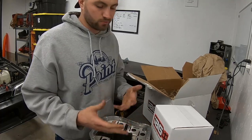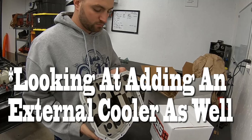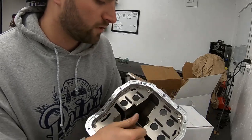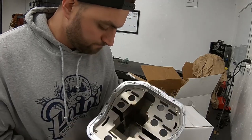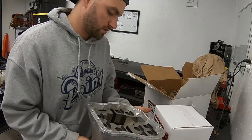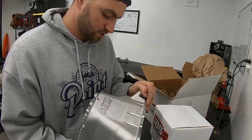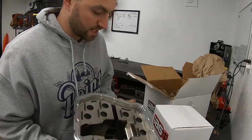The cooling fins are kind of what sold me on going with IAG — just adds a little bit of extra cooling. Subarus come with that stock oil cooler bolted above your oil filter, but it really doesn't keep up for track use. They have two different options: the street and the competition. This is the competition — there are little rubber doors that keep the oil from pushing back up onto your crank. The machining looks nice and it seems like a serious piece of kit.